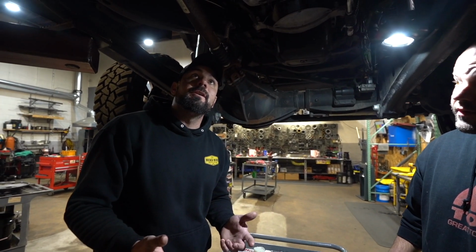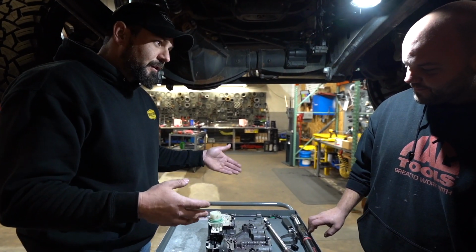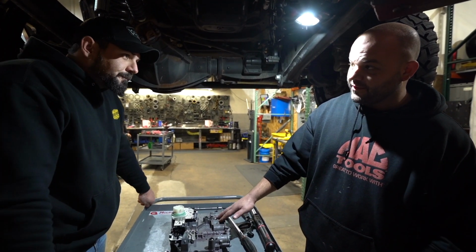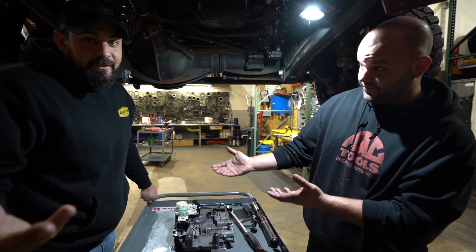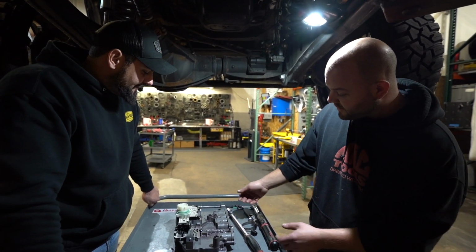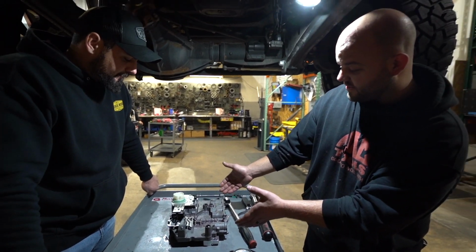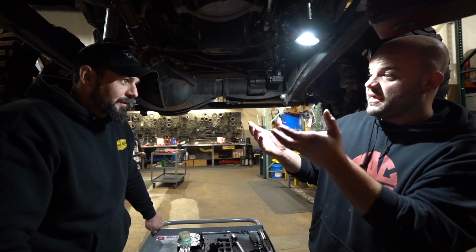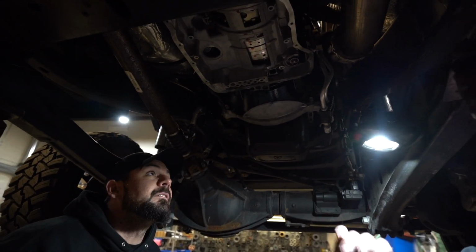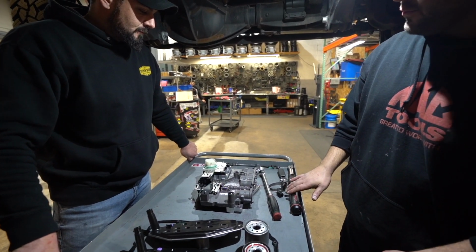We'll get that installed and show you. We've got some torque sequences that we need to do correctly. It's also helpful to have a friend, if you can. If you have friends. Some people like working alone. But it's a little bit heavier than your factory one with the billet channel plate on there. An extra set of hands to hold it up in there while you start your six bolts in, snug them up, and then go back and torque them.